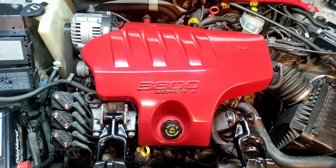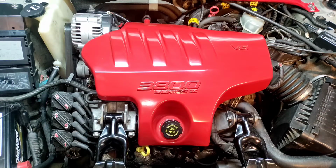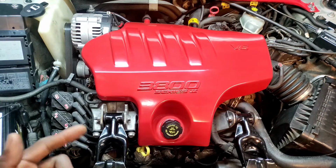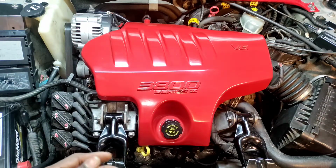Now, I put a note in the last video of what I screwed up, and hindsight is 20/20. I could have definitely handled this differently. I scoped the 3X sensor when the values were present in the PID data on the 18X sensor. So, my mistake. The 18X sensor is the more integral sensor, but the PCM utilizes both the 18X and the 3X sensor for feedback information to operate the vehicle optimally.